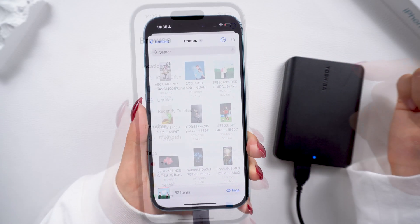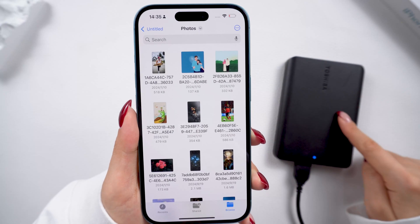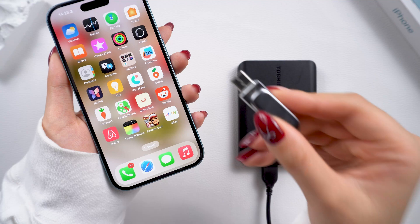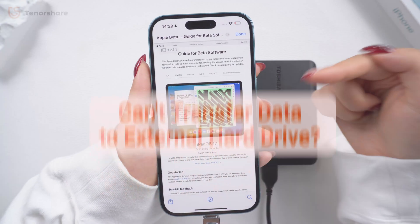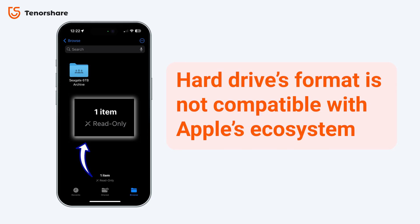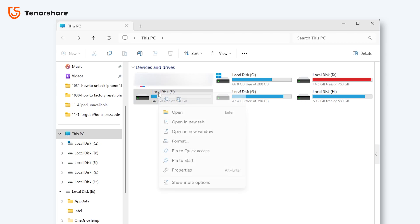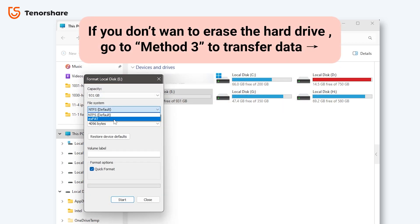Next, create a folder to store them, and then tap Save in the top right. After a while, you can check the photos on your hard drive. You can do the same with a flash drive and transfer other data in the same way. If your hard drive shows as read-only after connecting to your iPhone — meaning you can't save new data to it — it's likely because the hard drive's format is not compatible with Apple's ecosystem. To fix this, insert the drive into a computer, format it, and change the drive format to exFAT. Then you'll be able to import files from your iPhone.